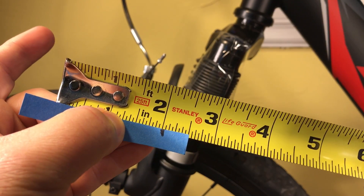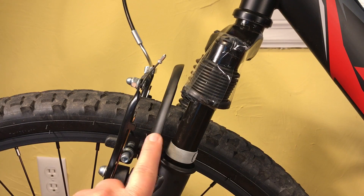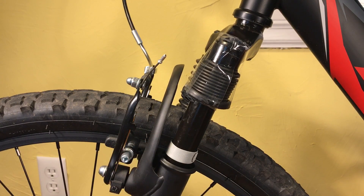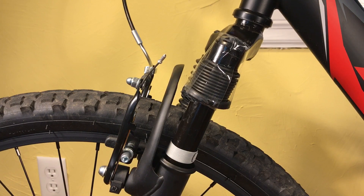I got right at a half of an inch. So that's one half of an inch — when converted to millimeters, that is 12.7 millimeters. I want you to think about that for a second. This suspension on a quote-unquote mountain bike — it doesn't matter if it's a $99 mountain bike or a $500 mountain bike — it has 12.7 millimeters of travel on that front suspension.